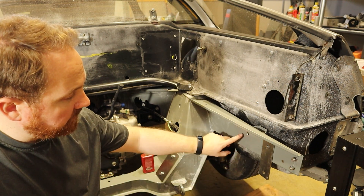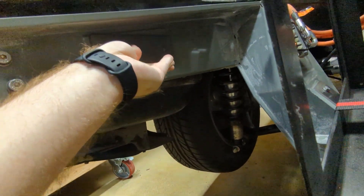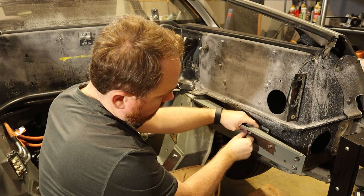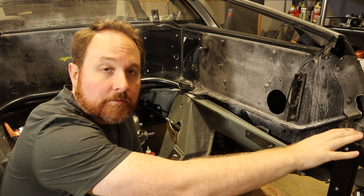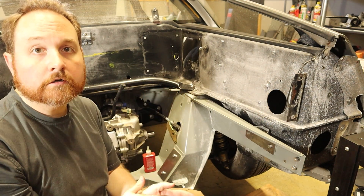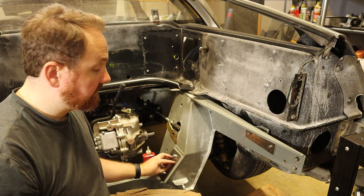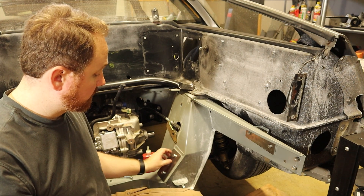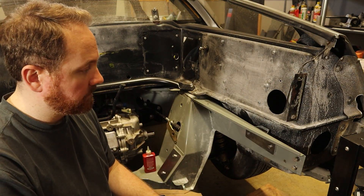So what I did was take an existing reinforced part of the frame right here and put two holes in it. I got another little bracket from SendCutSend and I can put this right here. With these plates installed on both sides, I'm going to get the battery box in position, put the rear bumper on the car to make sure everything fits, and then I'm going to weld between these brackets and the battery box — that's what will hold it in place. This way, if I ever need to remove the battery, I can just remove four bolts on either side and pick the entire battery up and move it out.